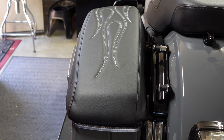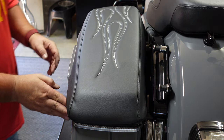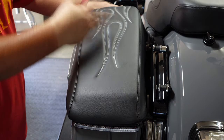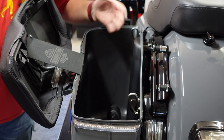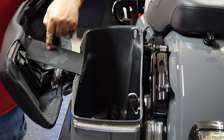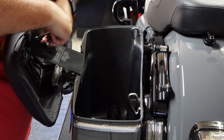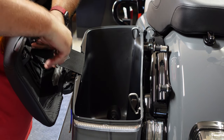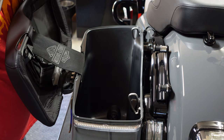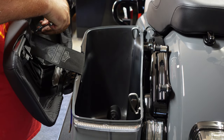I got aimed towards the bag. I have a piece of cardboard taped to the side of my bag, slid up underneath the latch. Take all your stuff out of the bag because you're going to be removing it. You've got two T15 bolts that hold on your bag strap, so take those off — but support your bag so it doesn't fly off. These are just plastic screws so they're not in there real tight, and don't overtighten them or you'll strip it out.